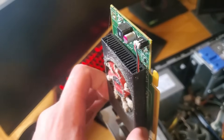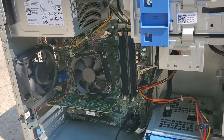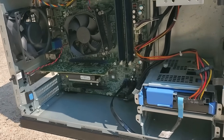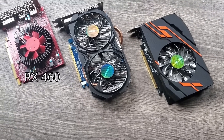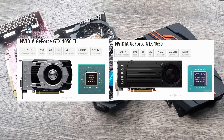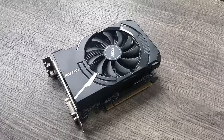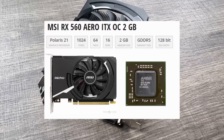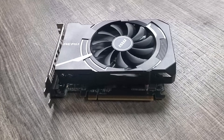Finally, the most impactful upgrade for gaming performance was the graphics card. My primary objective was to retain the existing 290W power supply without the need for supplemental power connectors. While I could have used a SATA to 6-pin adapter, I opted for the simpler, more cost-effective solution — selecting a graphics card that required no extra power. I already had a few GPUs on hand with low TDP, such as the RX 460, the GTX 750 Ti, and the GT 1030. I also contemplated getting a 1050 Ti or GTX 1650, but considering the cost and compatibility with our i5 processor, it didn't make sense. In the end, I settled on the Radeon RX 560, snagging this MSI OC version for $30 on eBay. My card may only have 2GB of GDDR5 VRAM, which isn't ideal, but it should perform adequately in less demanding titles, allowing for mostly 1080p gaming.